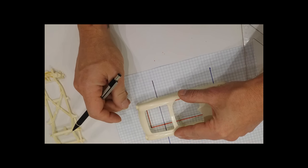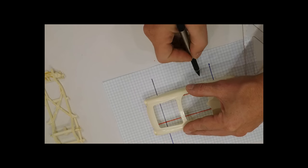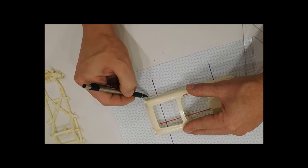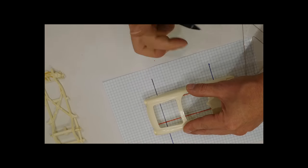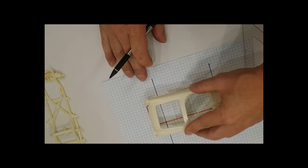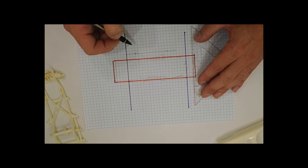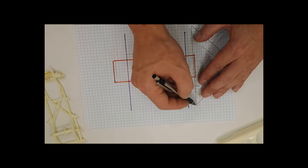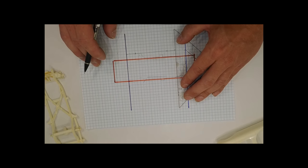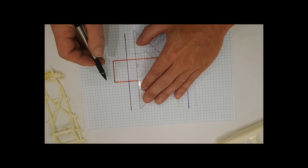So we're going to make, if I had to actually center this body, so I know my wheel well, this side of the wheel well is there, this side of the wheel well is there. Same thing here and here. That tells me how wide my wheel wells are. So we'll take those. And we'll run those across. This is basically becoming a jig to build your new frame off of.